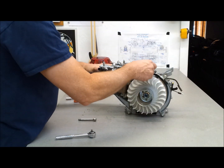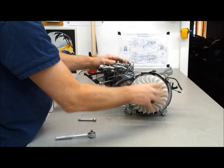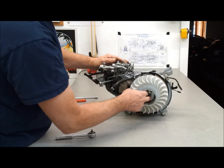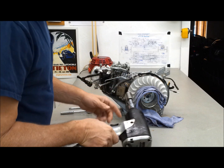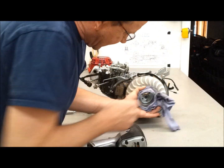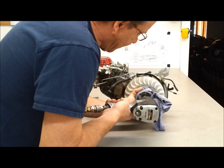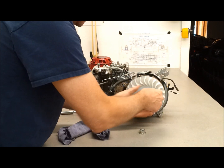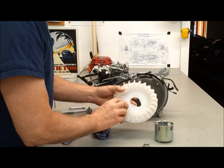Now I've got to decide which way to go — I think I'll take this all off first. I've got the compressor up today so I can use the impact wrench. I have my impact wrench here with a little extension and a 19mm socket. I don't know how tight this thing is but let's find out. That came right off — good. And there's the fan. A little dirty but it looks good.